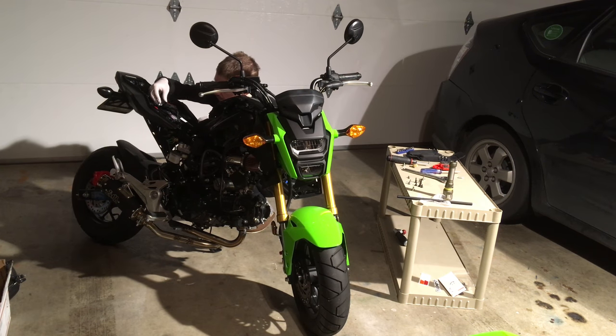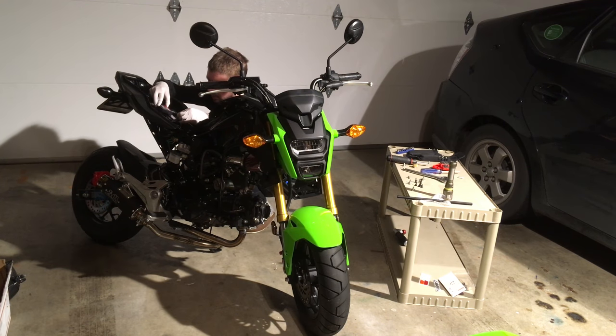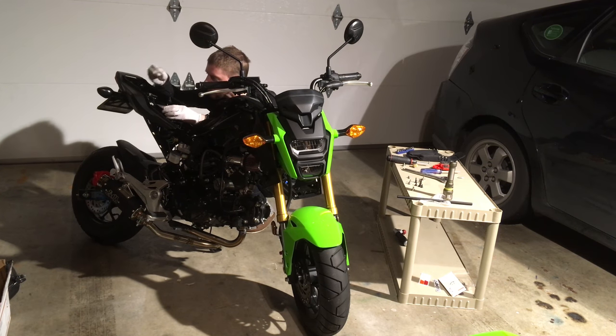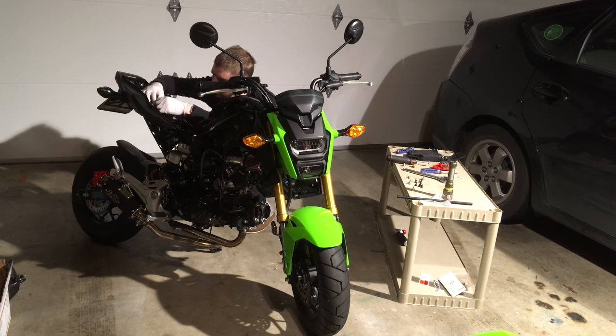After you get this Power Commander mounted, it's time to put everything back together. So find a way that you want to mount it. I just use a zip tie right through that battery strap and over the top, kind of near the status light area. That holds it snug, but I end up using the Velcro underneath along with it, and that makes a more secure connection.